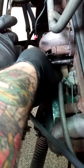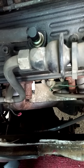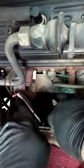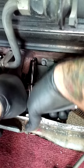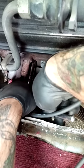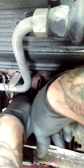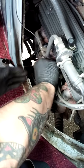It's kind of a bitch to tighten down, but this one's pretty easy — it's very accessible. You should probably use a torque wrench if you're going to do this right, but it's an old car so we don't really give a shit as long as it runs fine. Don't try and over-tighten these. Make sure it's tight, then seat the boot back on.